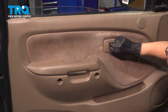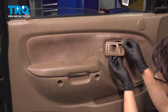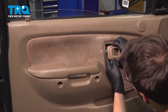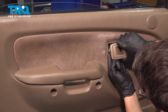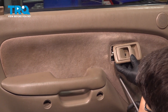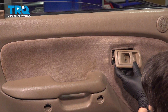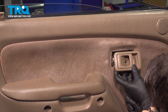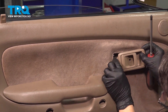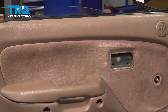Slide forward on the door handle — you should feel it unlock. Pull it away from the door panel, and if you look up top, there's going to be this locking tab. You have to pry it towards you, so out. Sometimes a screwdriver or a pick will help you pry it out. Once you get that out, you'll be able to slide the rod off of the locking tab. Set that aside.